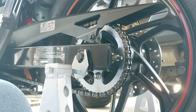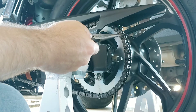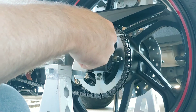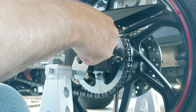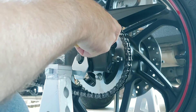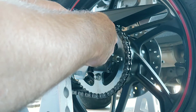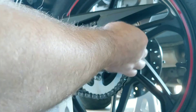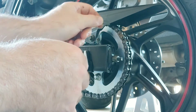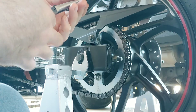This is super easy. You find this clip — the posts on it are going to be around just like that. Then you take some needle-nose pliers and get on the post on the back of this clip and push. If I can get right underneath and do it slow enough, I can actually just break it loose. That much pressure pops it out. Keep that in mind when you're putting it on — you don't have to put too much pressure, but enough to pop it on and off. You don't want to bend this, because this is essentially the key that locks that chain in place. Once you take this off, set it aside and save it.